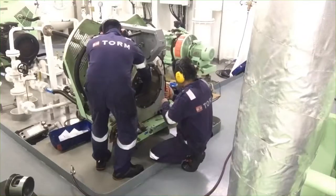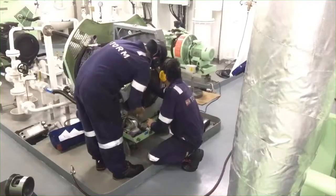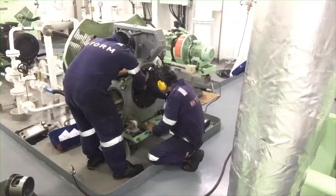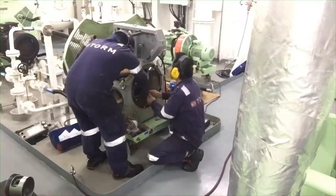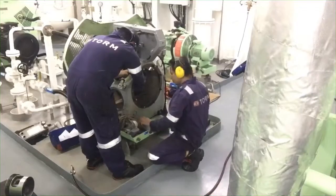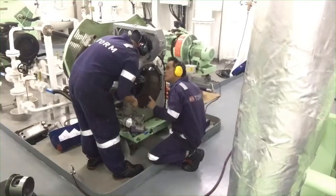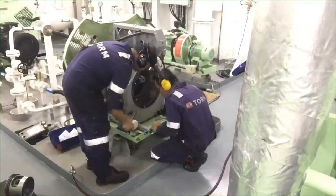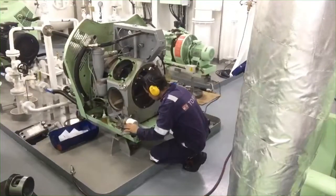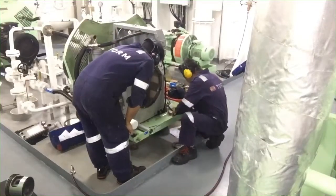When I took out this allen before, I used a hot gun in order to loosen it a little bit. Because if you don't apply hot air, it will not be easy to loosen these allen bolts. That's why during my box up now, I put some thread locker so that it will hold firmly and lock in its position, so that it will stay longer and keep your internal parts safe.